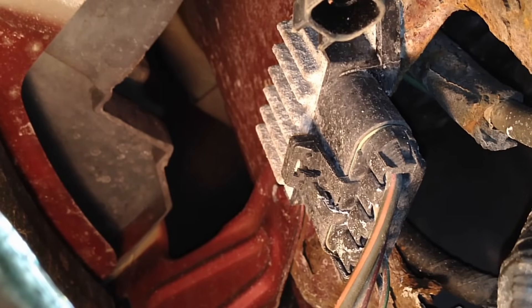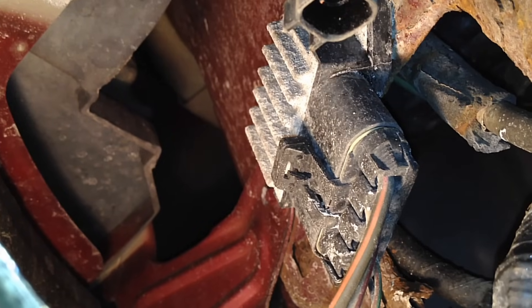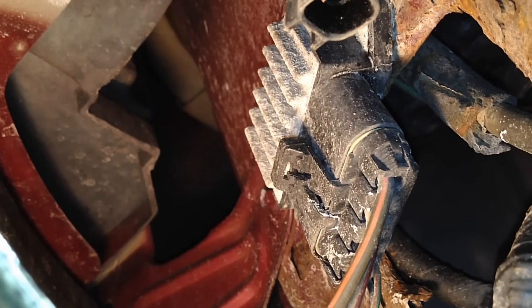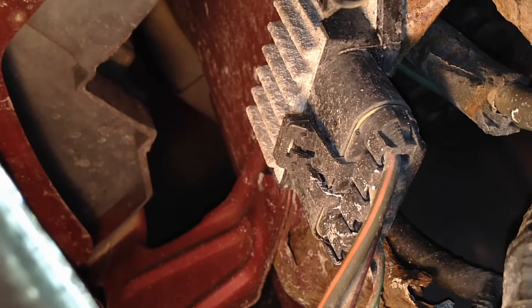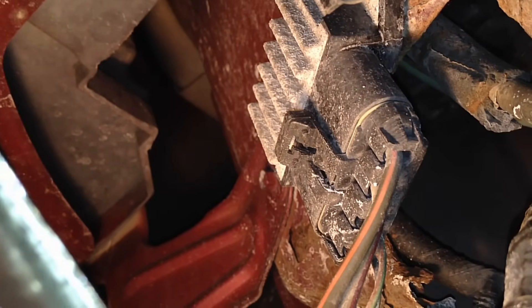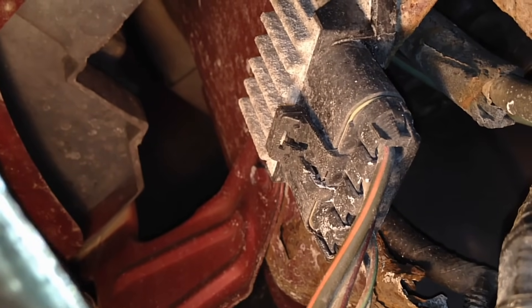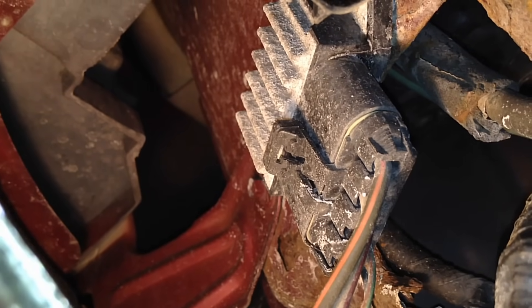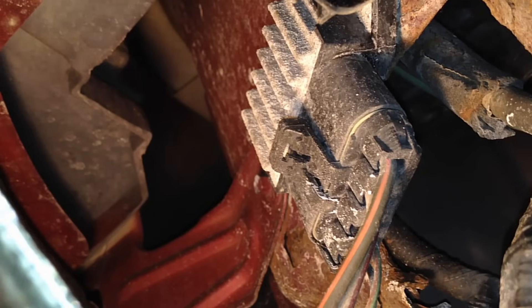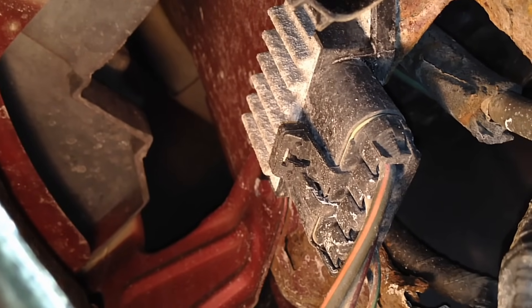Right underneath the air ride compressor is the air ride compressor relay — it's a solid state relay. With the key on and all doors closed, you'll come down here, disconnect this relay, then reconnect it, and all of a sudden the air ride will work, pump up the rear, everything's great. You'll think you've just reset the relay and it must need a relay.